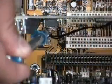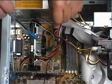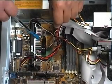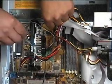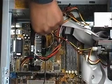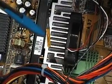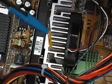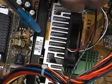After I plug the connector to the motherboard, I have to attach the temperature sensor, you see here at the end of the cable, to the metal heatsink of the CPU. The metal heatsink structure conducts heat away from the CPU and distributes it into a large finned area where the fan provides active cooling. I'll attach the temperature sensor to the heatsink very close to the CPU.